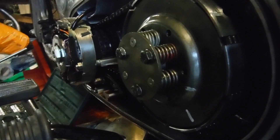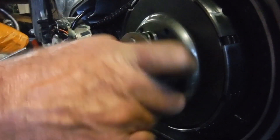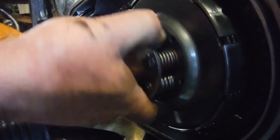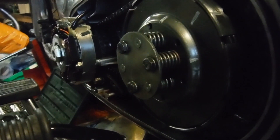One final demonstration of this clutch and how little drag there'll be now: I'll pull the clutch in at the handlebar — we're in neutral now — and I can spin the clutch center against the basket and friction plates easily with one hand. Obviously if I let it go we'd be trying to turn the engine and there's no way I can move it. Clutch in, spinning nice and easily, nice and true. I think we should have a good clutch there, and no doubt we'll get a road test before long — hopefully demonstrating that we can get neutral on it quite easily.